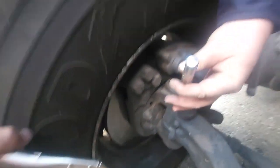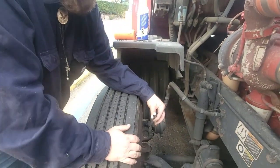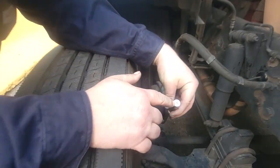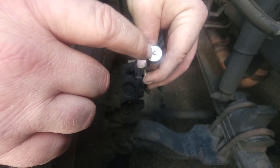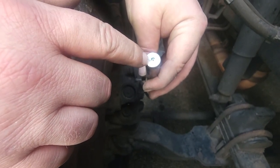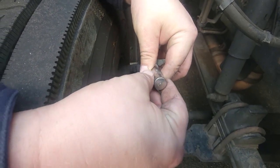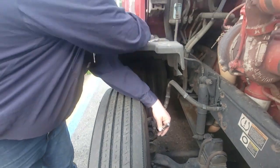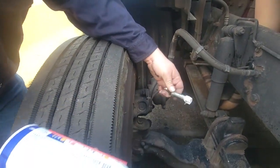When you get it far enough out, it'll just come out by hand. It's a little simple device but it causes a whole lot of havoc. Since it's magnetic and doesn't have grease, you'll see little metal shavings on it — that's from the tone ring. The tone ring has carbon in it and is also magnetic, and this buildup will actually stop your sensor from reading. So you just gotta clean this off, spray it with a little bit of grease, and spray some grease in through the hole — it won't hurt anything.